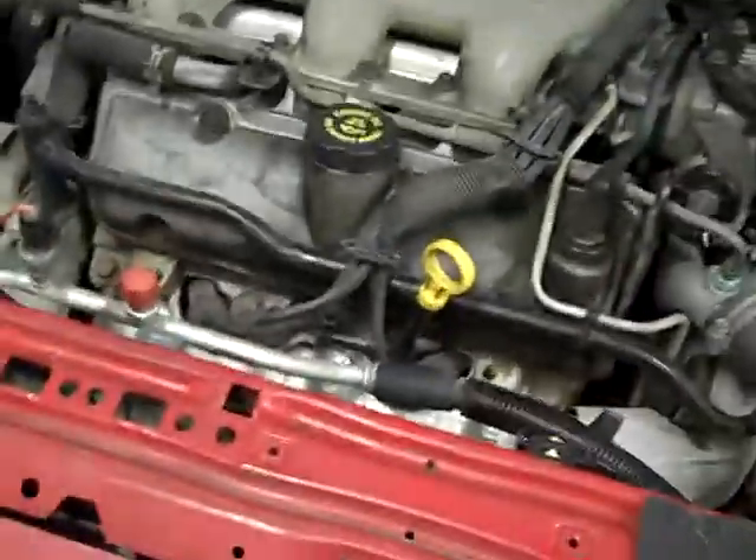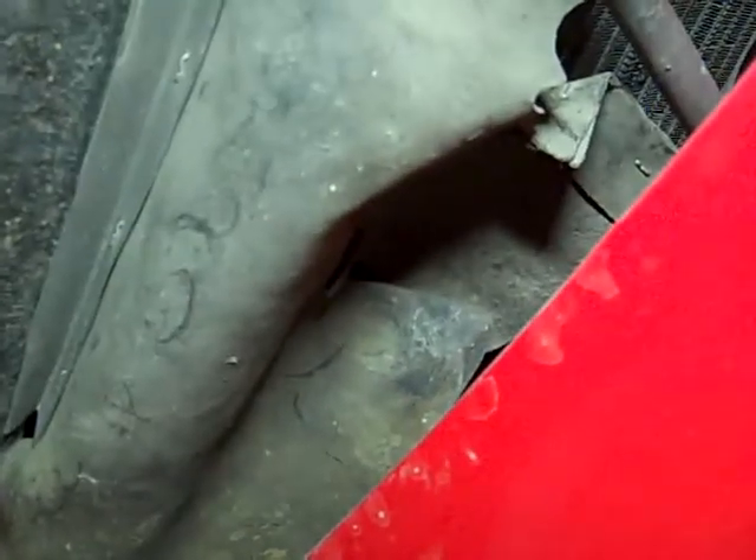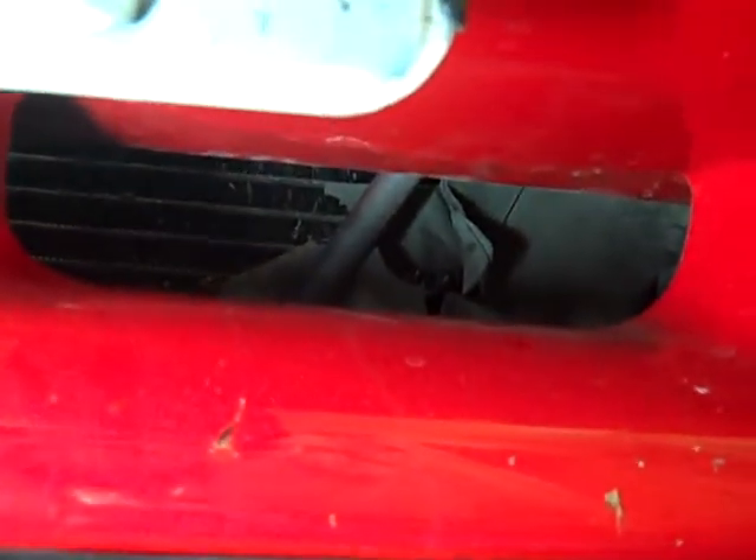So the headlight wasn't aimed, missing a couple little cheapy pieces. Now let's go underneath the car to where the really fun stuff starts. We are now underneath the car, underneath the front bumper on the driver's side. You see this wadded up piece of flexible rubber? That is supposed to be directing air through the condenser and the radiator, not wadded up in front of the condenser. Because it is blocking — you can see it through there — it is blocking that very first hole and half of the second hole on the front bumper. That's the only place the air comes in through the radiator on the front of this car, and they're blocking a third of the airflow that's supposed to go through my condenser and radiator.